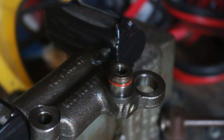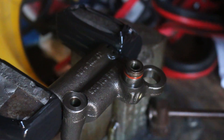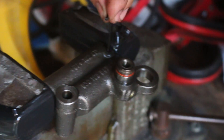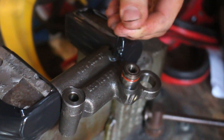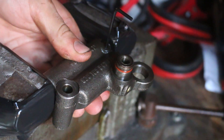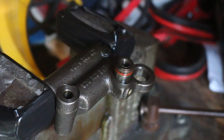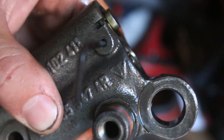These things are filled with oil and they're really difficult to compress by hand, so you put them in a vise. The book calls for a Porsche retaining pin, but we're just jamming an Allen wrench in there because it works. That one didn't work, but trust us, it works. I stepped in and did it and it worked great.